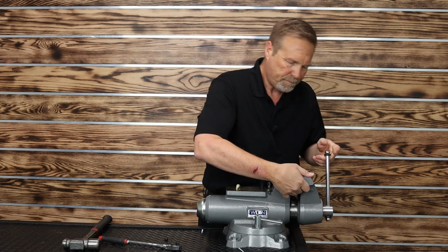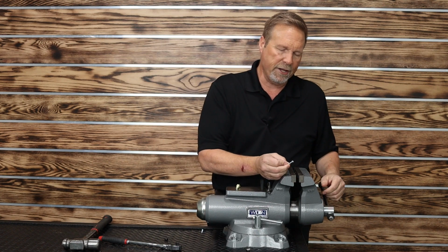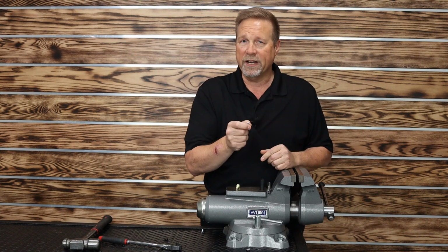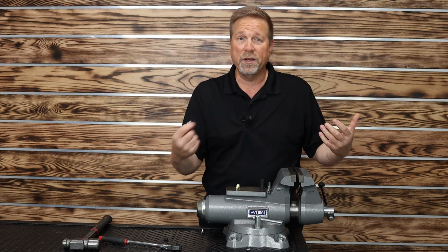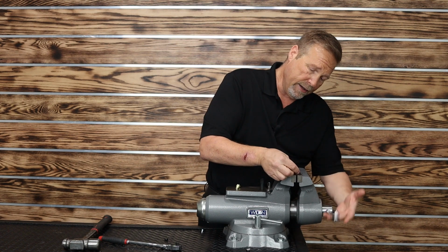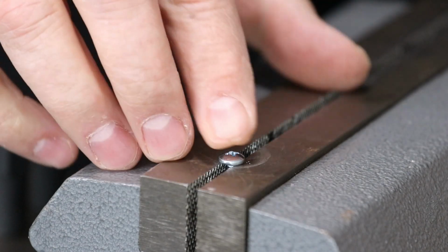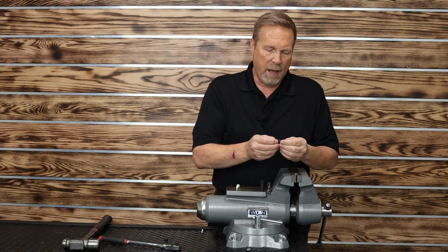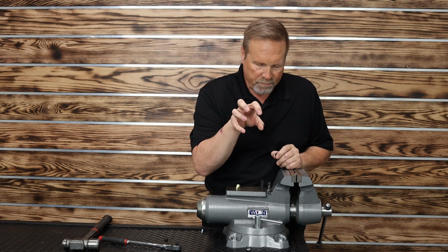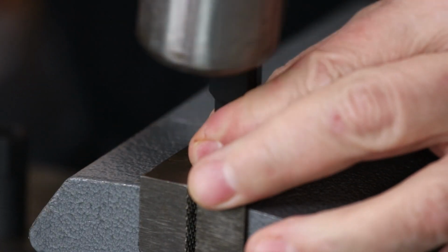I came up with this at Tool Fair when we were down in Orlando with the distributors. So this is a regular Phillips head button head screw. And you know, guys, when these things round out, they are super hard to get out. I don't care if it's in plastic in your kids' toys or it's in metal or whatever. When you strip these out, they're difficult, right? So we're going to drop it into the vise. I want you to make sure you see that it is in fact flush, like a real world situation. And we're going to grab our 1/4 inch drive socket extractor, and I'm going to show you how well these bite in by attacking it from the outside edges. So let's see if we can get this bad boy to bite in.